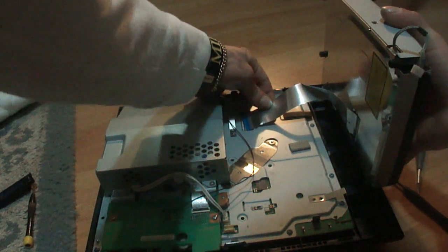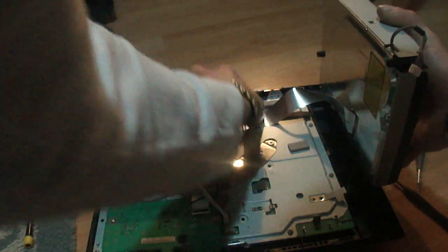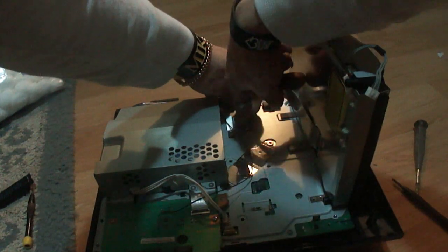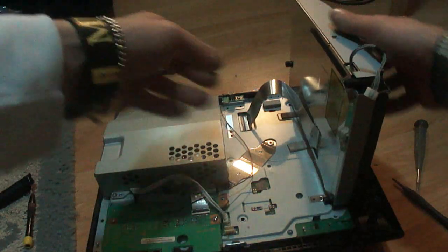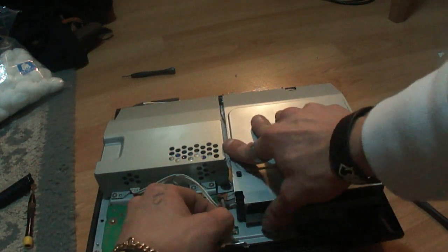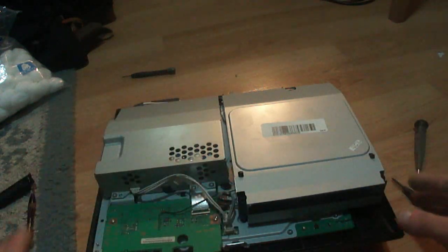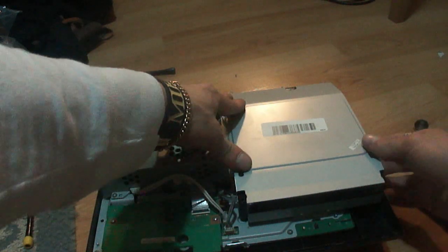I like to leave this on its side like this to make it easy. Just go ahead and slide that on in, make sure the flap is up, and then once it goes in as far as it possibly can go, just put the flap down. Flaps down, sitting flush. Then we just take this and flip it down like this. Line it up with the grooves. And plug the plug in. And there you go with that. So now that that's in there, you can also kind of just pick this up and give the drive a little snug just to make sure that it's in there properly.